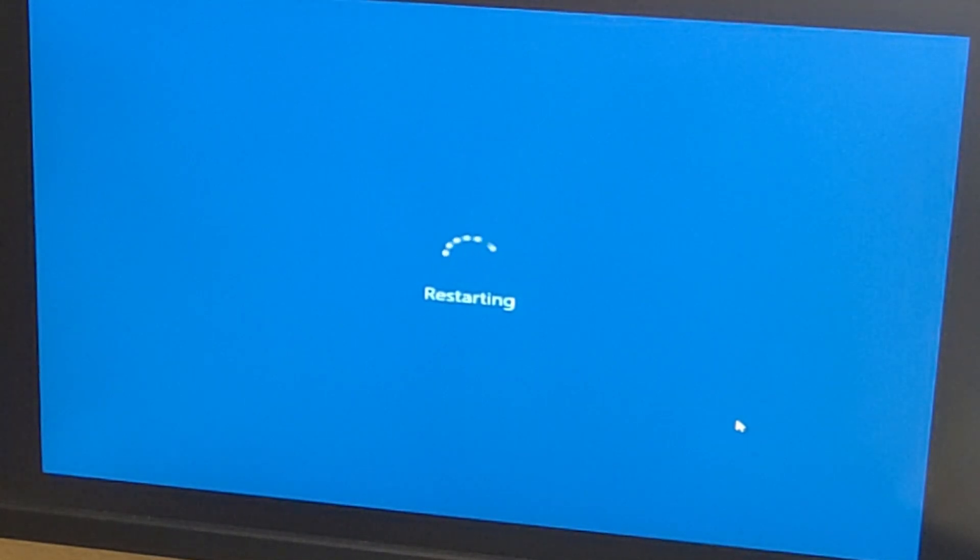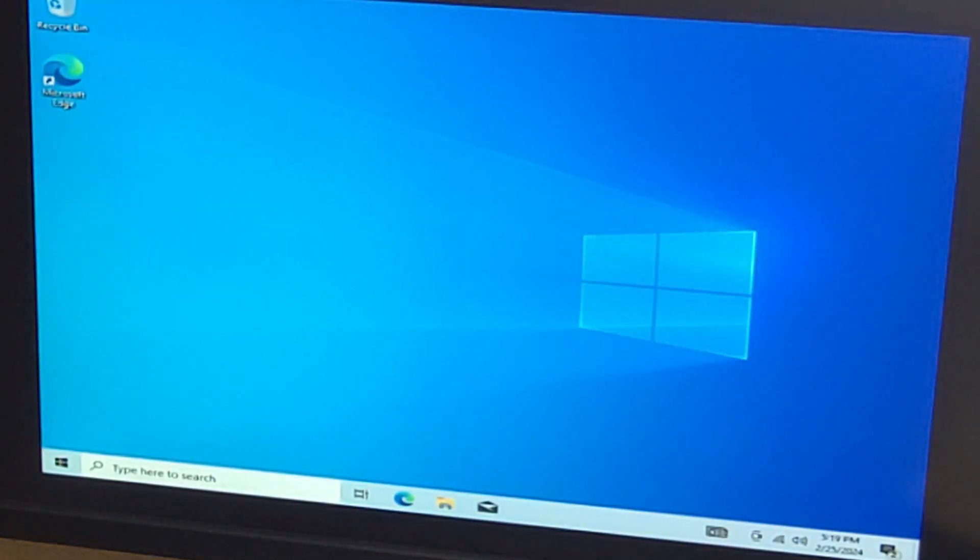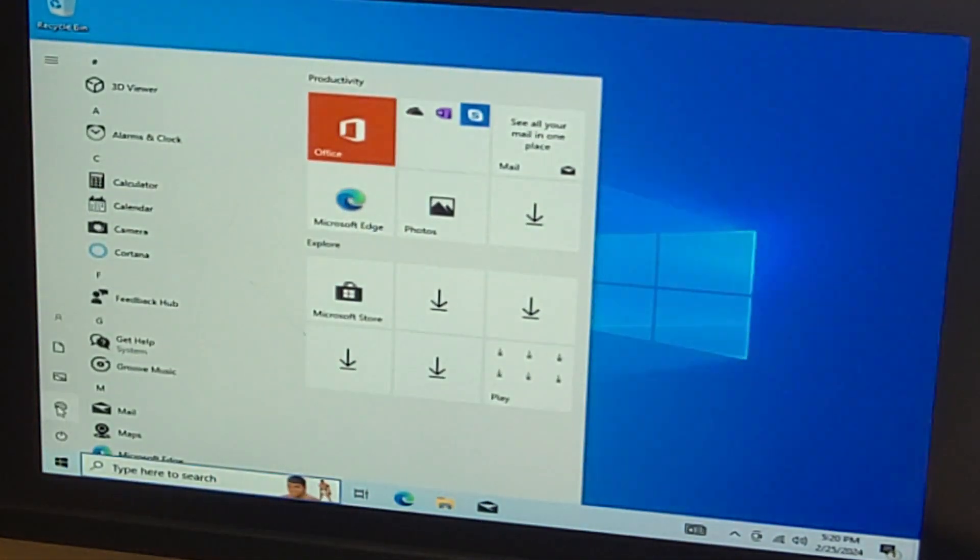With proper drivers the system will restart and boot up faster. This drive might not stay with this system. At the least I'll put it with the other Dell XPS I have - it looks similar but it's a black model with an i7-4770K or 4790K. I might swap the one terabyte drive from that system into this one and put the 500 gig into that other Dell, so that system gets a 120 gig SSD and 500 gig HDD, and this system gets a one terabyte drive.